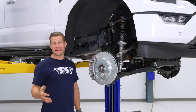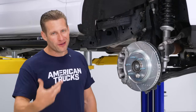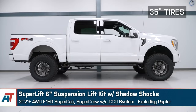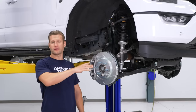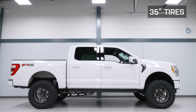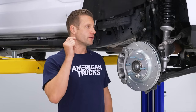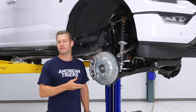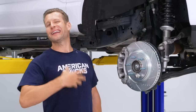We're starting out Stage 2 here with a biggie, and I mean that literally. A lot of guys with these blown or supercharged F-150s tend to go low for more of a street truck vibe. Well, I'm kind of a traditionalist — I wanted to go up. So I went with the Superlift 6-inch lift kit for the 2021 F-150. We've got the nice iron drop knuckle, all of the cross members, quarter-inch plate steel, CNC cut — just a really nice fitting kit. This particular kit does necessitate a 20-inch wheel or larger, and they give you specs for offset to fit a 35-1250 tire. To fit a 35-1250 on a 20x10-inch wheel, you need to run somewhere between a negative 18mm and negative 24mm offset, which I think we nailed.